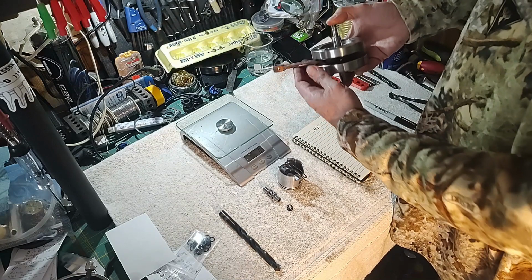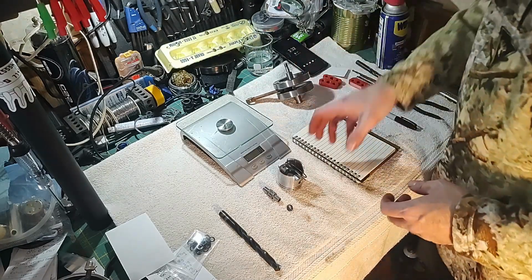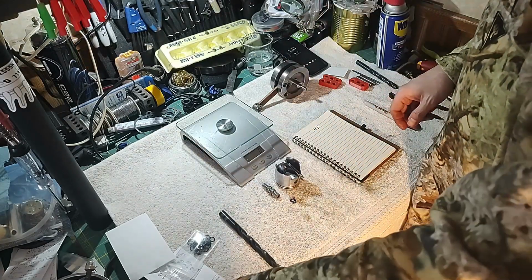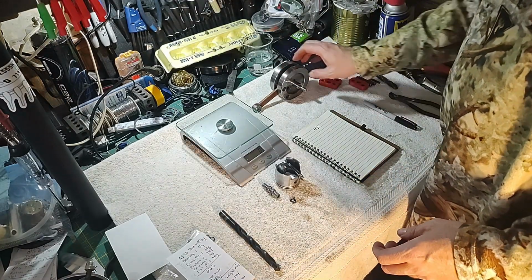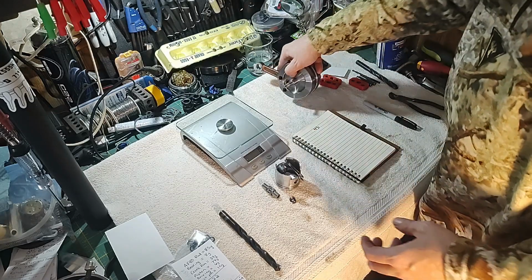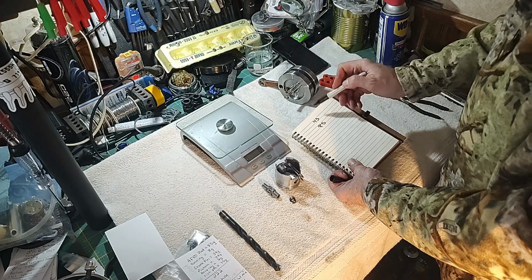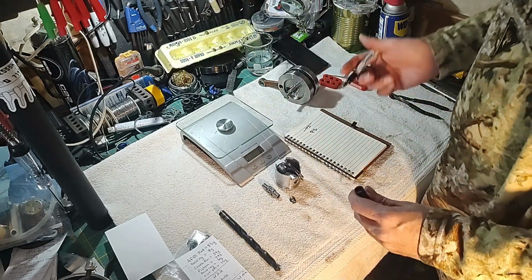So we really need the weight of the whole connecting rod, the bearing that's inside of there, our piston, our pin, our bearing, and our snap rings. Luckily, there's a few people on the internet that have weighed just the rod after they've blown up a crank. So this is an AF80 rod, and according to the internet information, that's at 85 grams. So we would have been off by quite a bit here, 42 grams off. So that's not good. So anyway, we're starting off with 85.